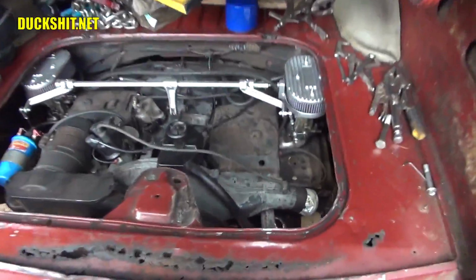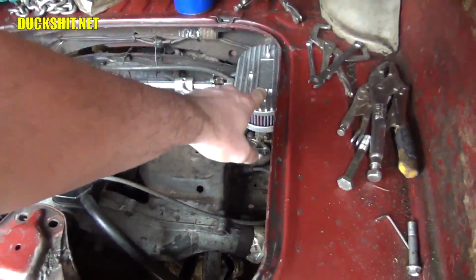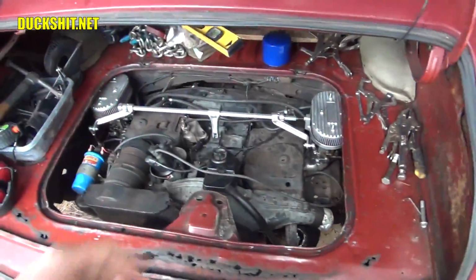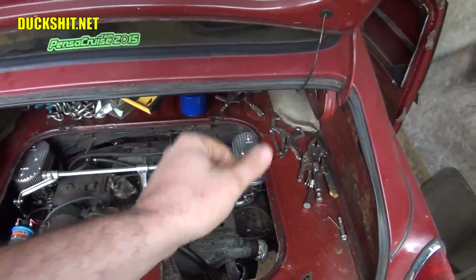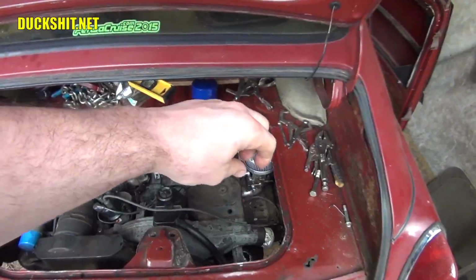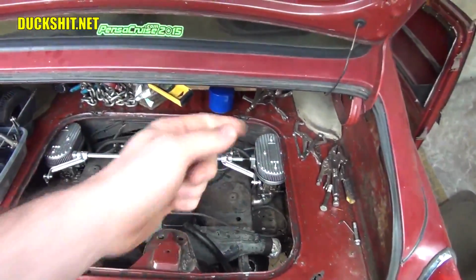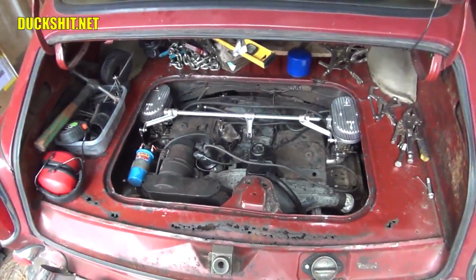Oh, in addition, where the wing nuts go, right through here. Once these studs are in place, it is impossible to put those lids on. So what I'm going to do is take the wing nut, screw it on, and weld it on at the top. So that way I can actually unscrew the entire stud and take it out of the air cleaner that way. I think that'll just make everything much easier to work with.